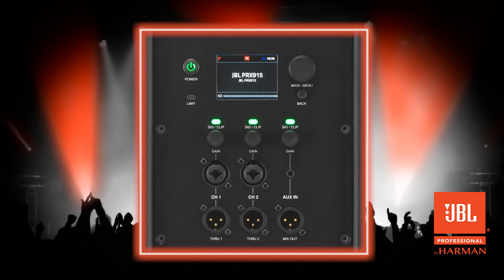To perform a manual hard reset, press and hold the main/menu and the back buttons for about 10 seconds until the channel lights begin to flash red. The unit will power off, then back on again, and the reset will be complete.